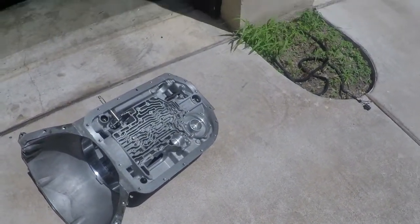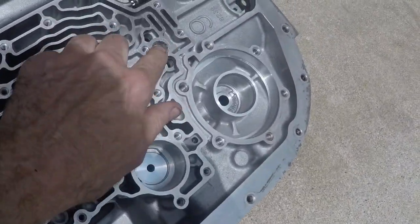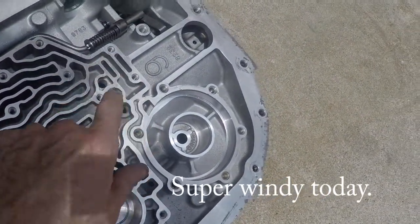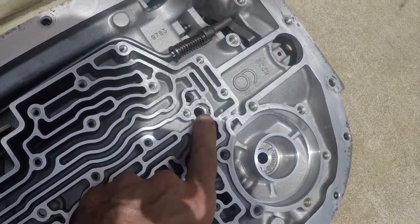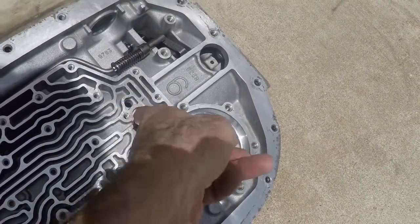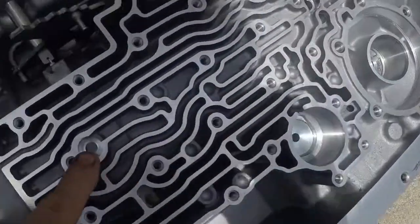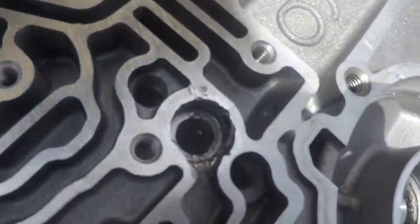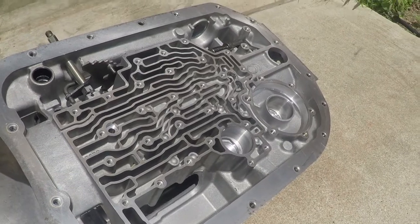Because I had to drill that bolt out, you can see it right back here in the back — it's a mess, but it's flat now and it should bolt in there. This doesn't actually seal anything; it just supports that rear shaft. There's a hole going through here so any leaks around here don't really matter — that should still support it. It's supposed to look like this other piece, nice and pretty. It's a little chewed up, but I've never had a bolt like that in a transmission — that was unusual.